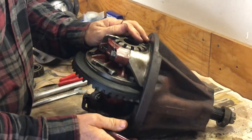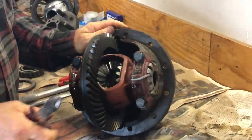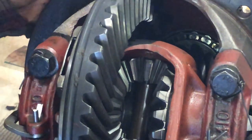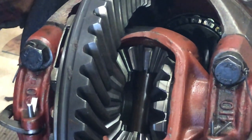There is one adjustment we have to be careful with. There's a specific distance from the top of this pinion down into the diff to an imaginary rod going all the way through the diff center — that's very specific and has to be a certain value, so we'll check that later on.